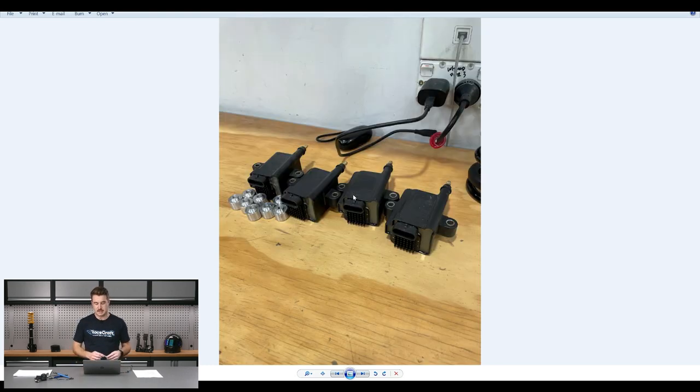Here's the ignition coil sitting on the bench — we can see all four coils. This is a pretty common style of coil you'll see being used in motor racing, particularly on a lot of rotaries. It's a really high quality motorsport style coil, completely generic and can be applied to everything. We've been running an aftermarket coil-on-plug coil that we've been having quite a few problems with — not only reliability issues, but they're actually really hard to use and it's really easy to damage them when putting them on and off the engine. Since we've been taking spark plugs out quite regularly, it seems to be a better option to go to a more universal motorsport coil where we can run our own HT leads and get a lot more flexibility.